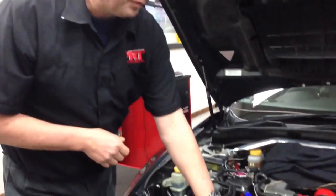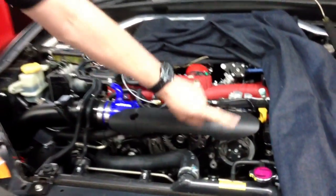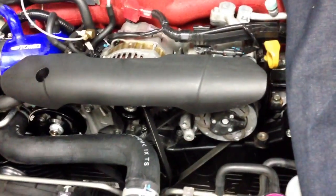Other little things: the original radiator is more than adequate. You can see down the bottom here the GFB alloy pulley kit, which is now fitted with all the other parts. You may ask what this is — it's connected to an air blower which pumps air constantly into the top mount intercooler when we're running the car on the dyno. With a Subaru you've always got plenty of airflow through the radiator, but it's always a challenge depending on whose dyno you're using to get reliable inlet air through the top mount intercoolers and do consistent inlet temperatures under load. This gives us really stable inlet temperatures under heavy load because we've got a stable amount of air — it's like a ginormous windsock when the fan turns up.